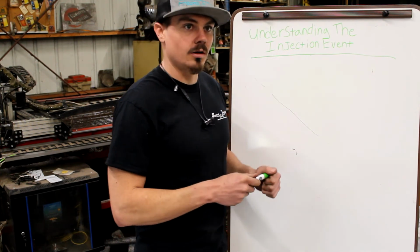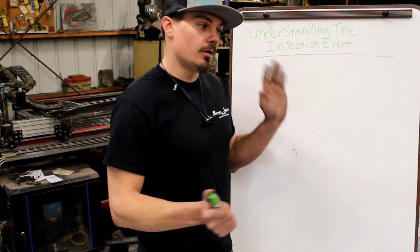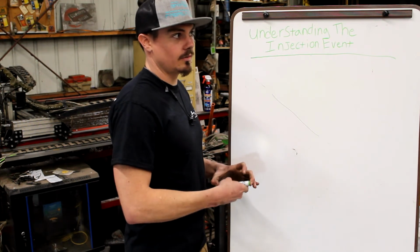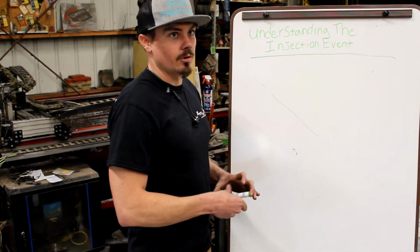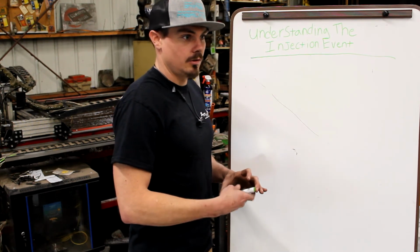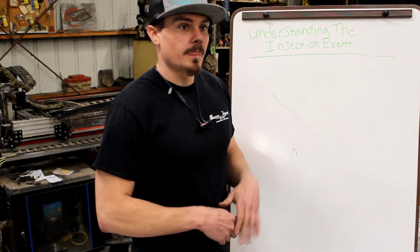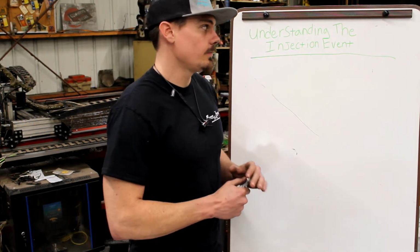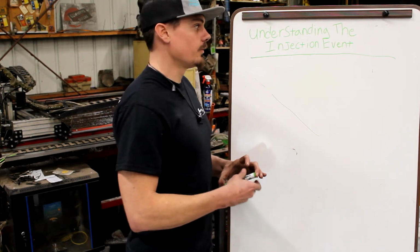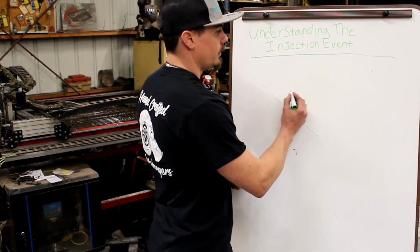I don't think I've ever seen a cracked body for a 12 valve or a 24 valve. I could totally be wrong again, but we only run, I want to say, 6,000 to 6,600 PSI on a P700. We can raise that up to, I think, like some of the big pumps, 7,000, 7,200, but we're nowhere near the 30,000 PSI that you see in common rail systems. That's why our injectors tend to have to be a lot bigger to make the same amount of horsepower than what it would take in a common rail. And we're really being real careful with that duration of it.